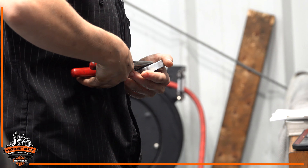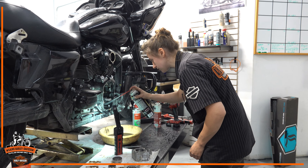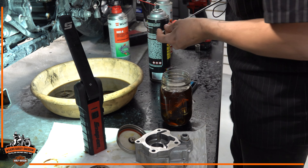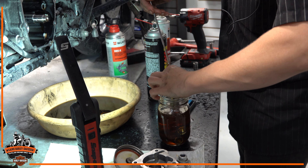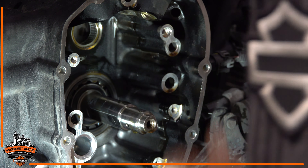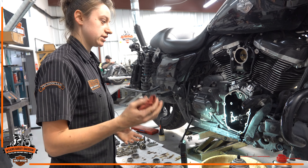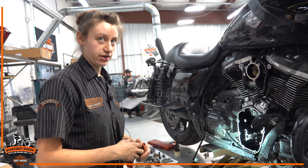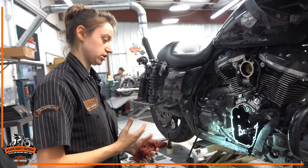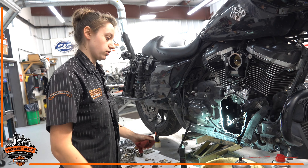Place our seal on the back of our oil pump, then install our lifters. Once you get a new camshaft, if you've got any mileage on it, the cam and lifters start wearing together. So when you replace one, you want to replace the other one. That way everything has a nice even wear pattern — no old lifter wearing into a new cam or a new cam wearing into old lifters.